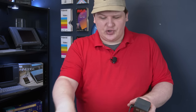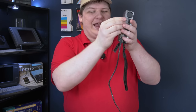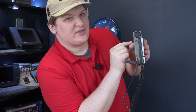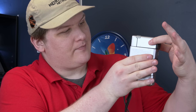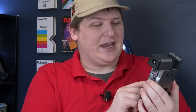Let's go ahead and juice up this camera. Running it off the AC adapter sucks because it plugs in the front, so the cable hangs out the whole time you're using it, with nowhere to put your hand. Now let's turn it on — and nothing happens. The lens cover is still closed. Modern camcorders might open their lens cover with a little solenoid, but in this era you have to open it by hand. There's usually a linkage coming off the mode control dial, but this one doesn't do that. Now it's open, and it's on.